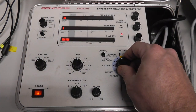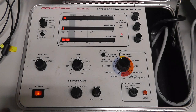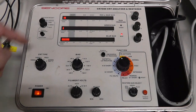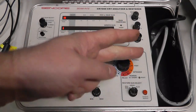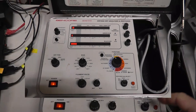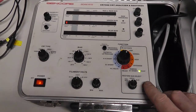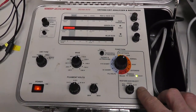Still nothing on the green gun — that's probably why the colors looked off. Checking emissions: no emission on the green gun at all. This is definitely going to be an interesting restore. I'll go ahead and hit the green gun — showing basically no emissions — so this is where you want the restore functionality, potentially even a rejuve, but we'll do restore first.